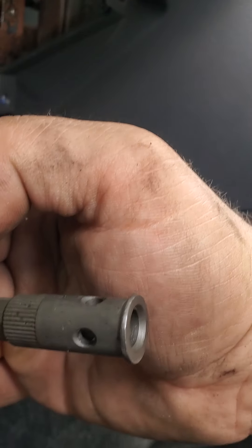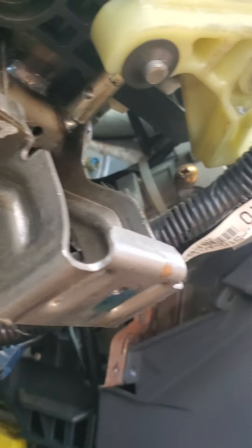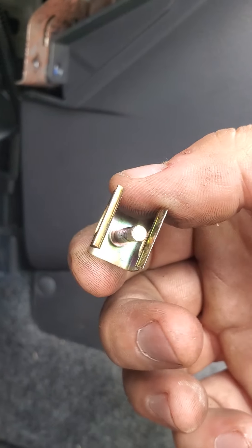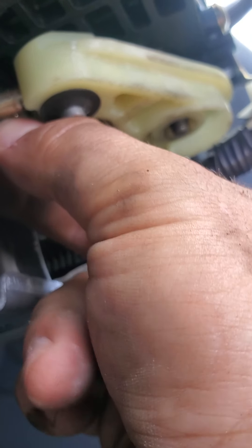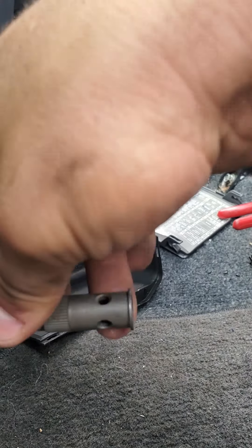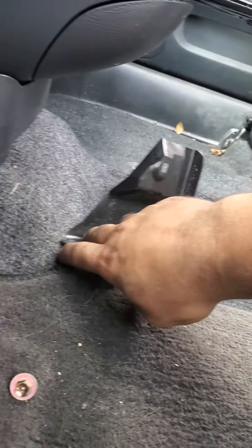But now, here comes this end. You don't have to do anything crazy, because I thought you had to beat out that pin or something — nah. So what there is, is there's this little clip pin deal that slides in there and goes around the outer housing of this cable right here. That's why it's got holes in it. So you just pop that off, it'll slide right off there, and that's pretty much everything you gotta do in here. I removed this piece because I couldn't tell if I needed to take it off or not, but I don't.